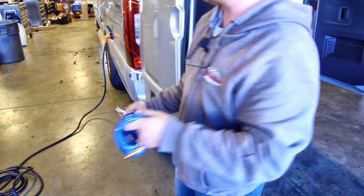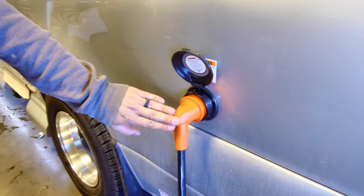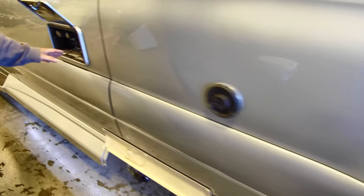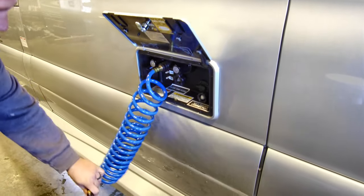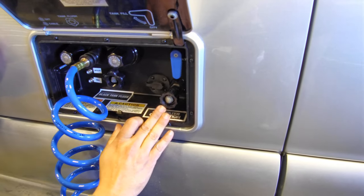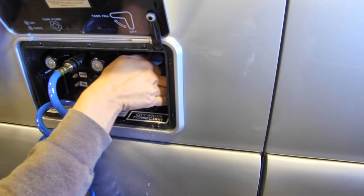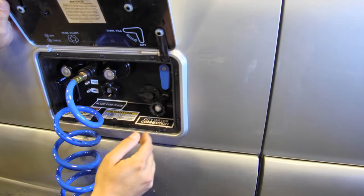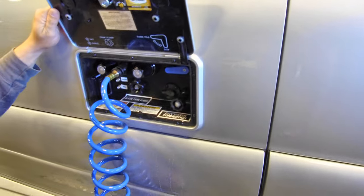On the driver's side exterior is where this hose will hook up. There's also a power cord for the shore cord — a 30 amp cord — and water hookups for your hose. Fresh water is all located inside here. You have a fresh water inlet, the city water connection — hook your hose into that. Above that you have a diagram showing whether you're running city water (down position for full-time hookup) or doing a tank fill (horizontal position), which fills your fresh water holding tank.